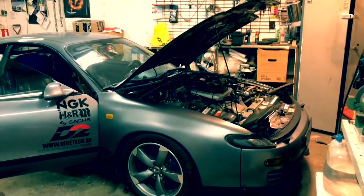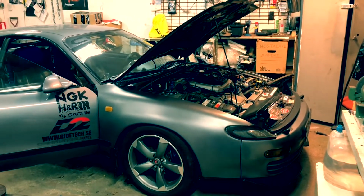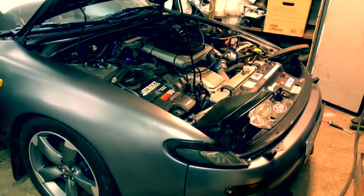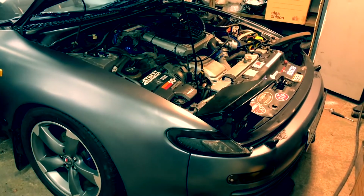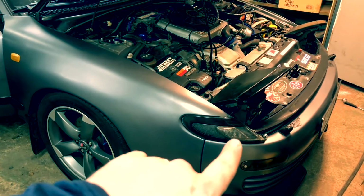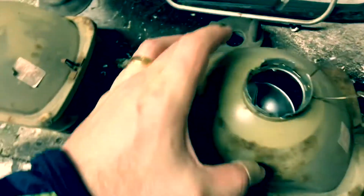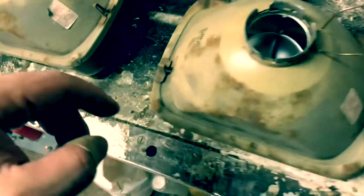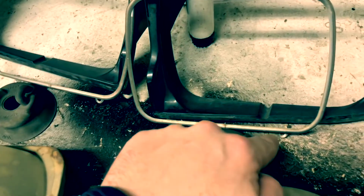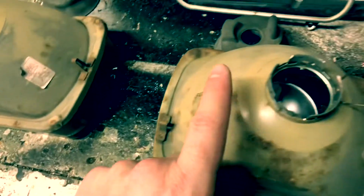And in my case, I'm not going to use them very much. I'm going to use them during night time because it's the flip lights here, which are mostly retracted and not used during the day. I'm using the side lights here mostly, and this installation works like this. You have 4 screws like this, and this is the only thing holding up the entire bracket and the headlight.